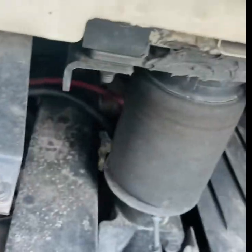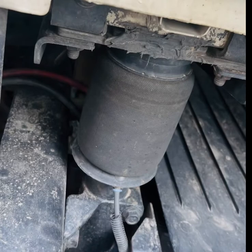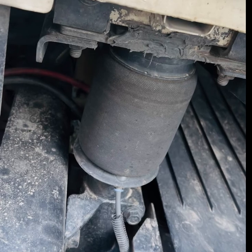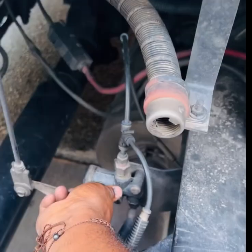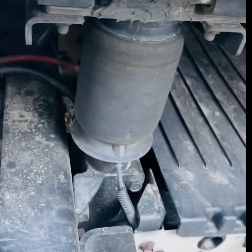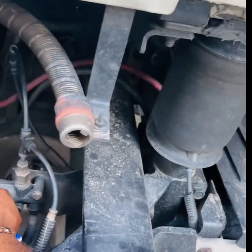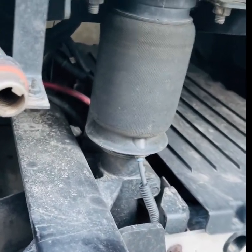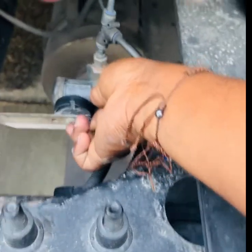If you move it to the left they go up. I was having issues — it wasn't really going up a lot because I didn't have a lot of air in my system, so I had to rebuild my air pressure and then it went up again. Just play with it and you'll see how it goes up and down. Now it is going up and down without any problems after I rebuilt my air pressure. That's really all you have to do to adjust the leveling valve whatever the reason is for your comfort level.